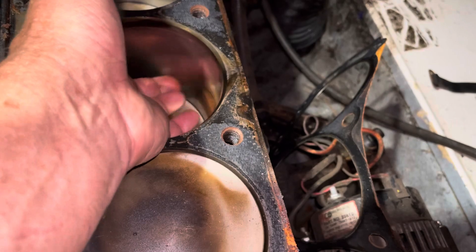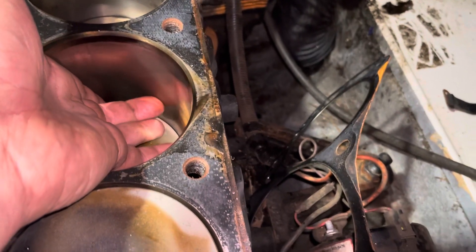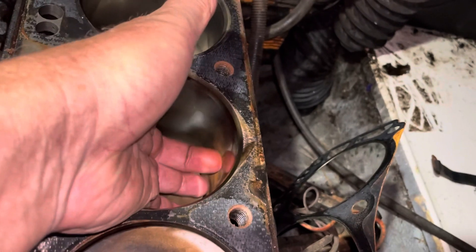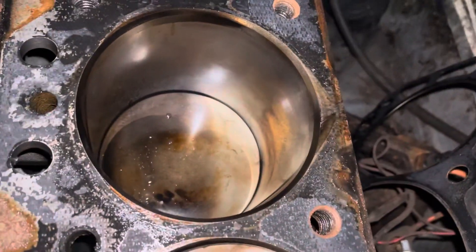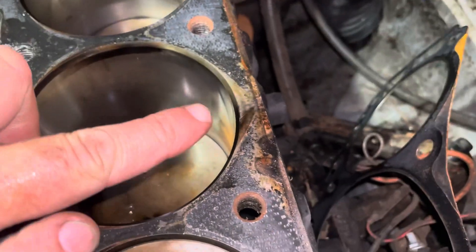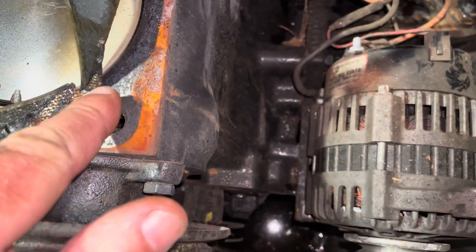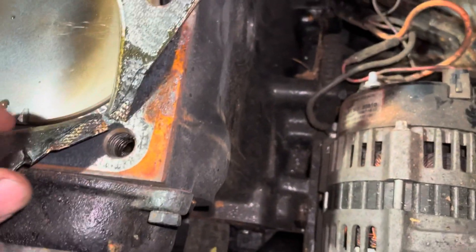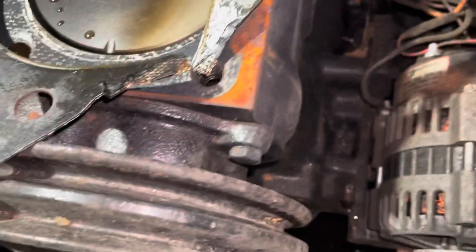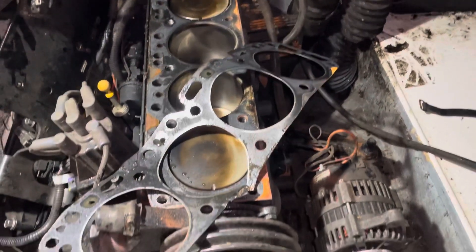If I scratch on a good cylinder wall there's nothing, no roughness at all. But you can hear my fingernail catching on the rust right there. I don't know if that'll hold compression anymore. There's where the gasket blew out — you can see it came out the side. The gasket itself is right here, that's where it blew. The fire ring had even separated and come apart completely. That's a blown head gasket on a 3.0 liter MerCruiser four-cylinder.